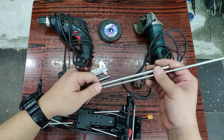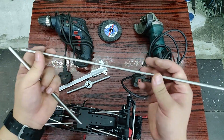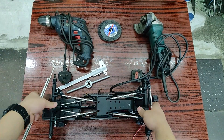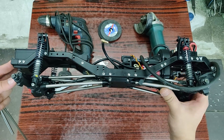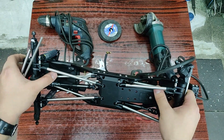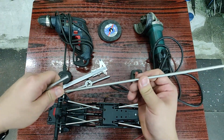Material-wise, I have a quarter-inch stainless stock and also 3/16-inch stock. This is basically up to you. I usually like to do my lower links with quarter-inch so they're beefier and thicker, while the upper links don't need to be as strong, so I'm going to lighten it up with some thinner stock.